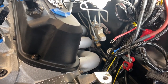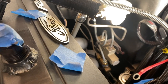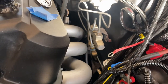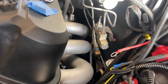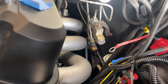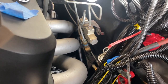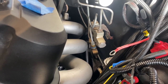Before you put things in the car, get your brake lines as far over as possible. Down underneath you can see I have some metal ties and I pulled my brake lines back. If you don't do that, I probably have a good half inch of clearance now. I might even put a slit spark plug boot around my brake lines for heat protection. If you don't have the engine in yet or headers on, it's far easier to get access down there — plan ahead.